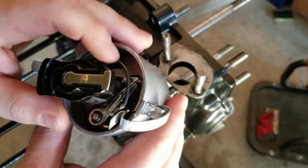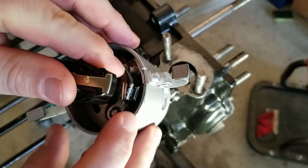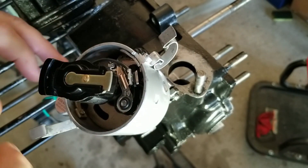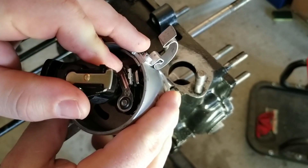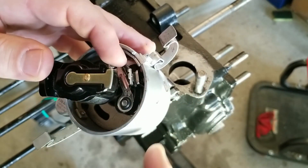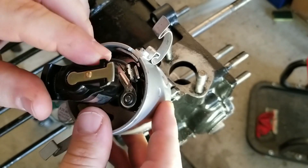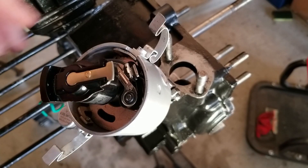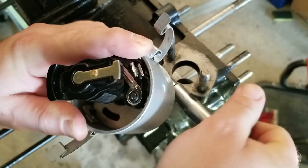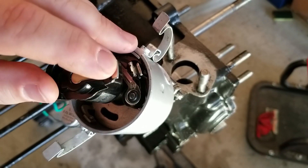As you're looking at the top of your distributor you'll notice that the hash mark may be way off, so you've got to turn it around. This hash mark inside the body of the distributor is your timing mark — you want to have your rotor centered right on that timing mark. As long as your rotor is pointing towards the front stud here of your fuel pump, all those timing marks should be lined up. Lock that down — now you know that as long as you have your rotor at that timing mark once you have your crank in place, your timing is good.